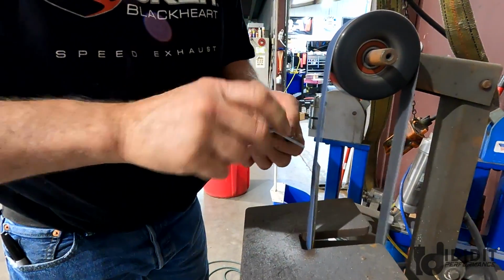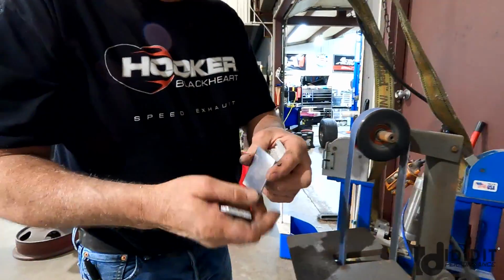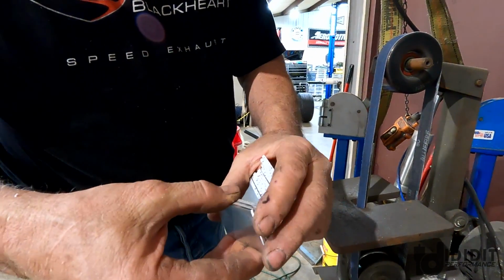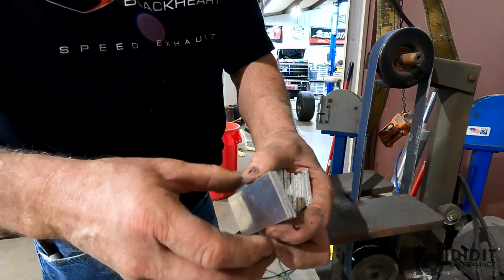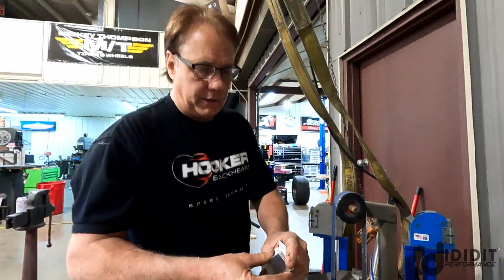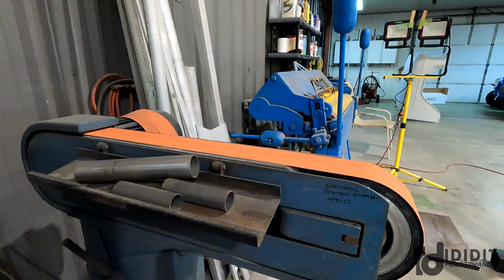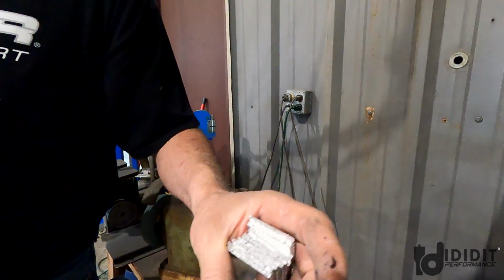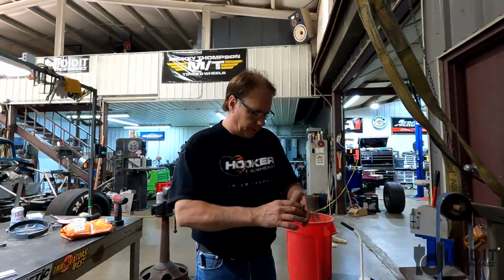Okay, so all I'm doing is knocking the sharp edges off so I can draw a radius around the end of it, and I'll saw that on a bench saw, and I'll show you how. But I'm going to do all the rest of these, and when I'm all finished, I'll use the big sander behind the 3-inch belt to clean up the saw marks on the edge so they'll look nice. So I'll get these done, and then we'll come back for some more.